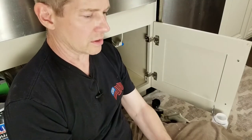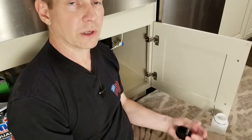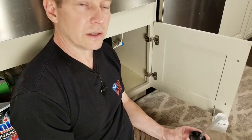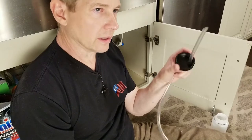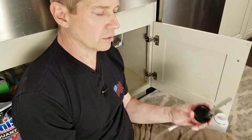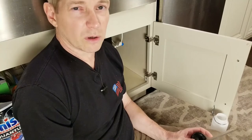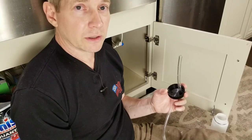So that was my fun little side project, kind of combining the garage and coffee. Coffee maker stops working, Brian stops working. I think I got that rigged up pretty cool. There may be a different, better solution — if you've got ideas, let me know. There may be a way to put that canister in line and use the existing water pressure, but I wanted to control the water and cleaning solution mixture, so this is how I did it. If you've got the Brew Express coffee maker with the 4E error, it means you're not getting enough water — either low water pressure, a dirty water line, or something like that. This is my solution. Quick break from the garage to fix the coffee maker. Thanks for watching the Daily Brew Garage. This is Brian — see y'all later.